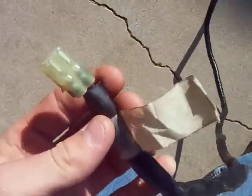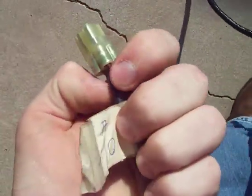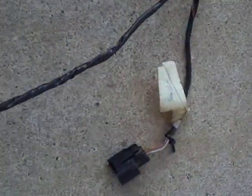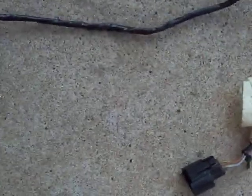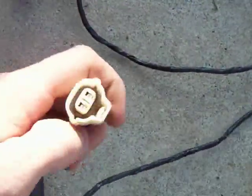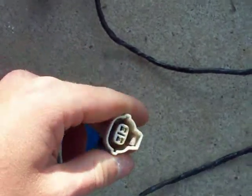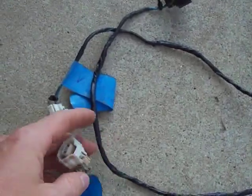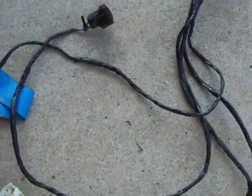Grounds. And then some long wire. This is the second oxygen sensor. And then I've got four plugs right here. This is the MAP sensor. And we've got the first sensor. The charcoal canister — I have a plastic one, unlike the metal one — and it's got three vacuum switches that connect to it, which are controlled.